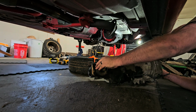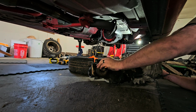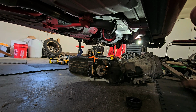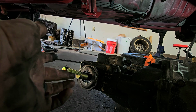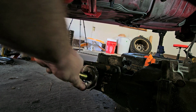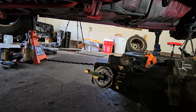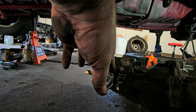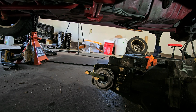I wonder if that's actually a Hurst shifter. I don't think it is. I think it's just a Hurst handle on a factory shifter. Why do I say that? Because a Hurst shifter, first off, that handle was mounted to this side. The original handle, I think, was mounted to this side. A Hurst shifter has adjustable stops, so you don't overthrow the shifter. In other words, when you're banging gears, going first, second, what's stopping it from shifting now is the linkage, the mechanism inside. And for people that are rough on transmissions, aka me, eventually you could break the shift forks inside. The Hurst shifters actually have a positive stop, so the stop occurs here, not inside the transmission. So that's why I'm thinking it was just a handle. Pretty sure that's a factory shifter right there.